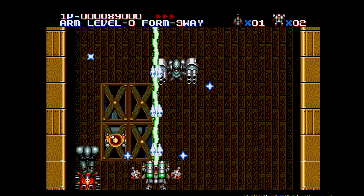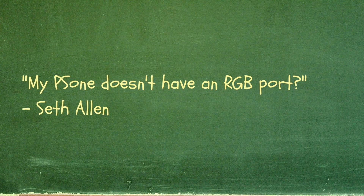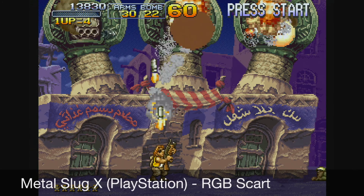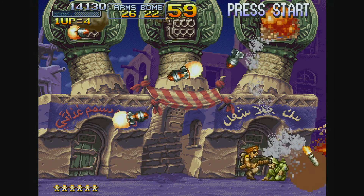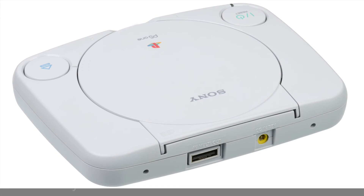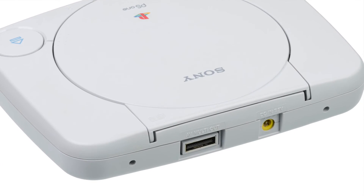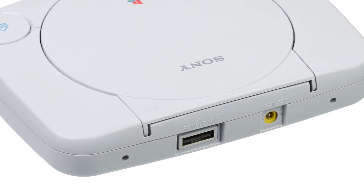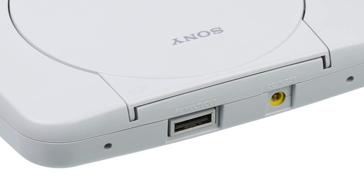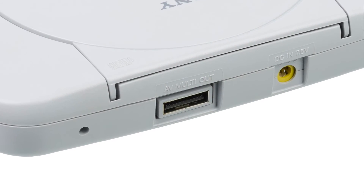The next question comes from Seth Allen who writes: my PS1 doesn't have an RGB port. Now, as we in America never really had televisions with RGB or SCART ports, this question might be more common than you think. Basically Seth, the multi-AV out port on the PS1 does in fact output RGB — there is not a special RGB port. There are 12 lines on the multi-AV out port including composite, chrominance, and luminance needed for S-Video, as well as red, green, and blue (RGB), so your PS1 is not missing any ports.